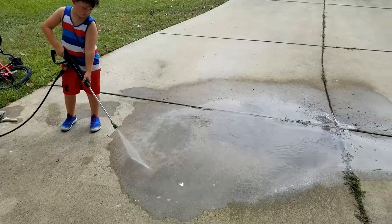We're out for the obligatory test drive after getting everything put back together. I got the front differential filled up with new gear oil — that Valvoline full synthetic 75W-90. So far after a few miles I don't hear any clings, bangs, pops, anything like that — so far all is good. I had my son pressure wash that old oil spot area in the driveway. I just wanted to get that area cleaned up, have a clean slate, so to speak, just so I can check tomorrow morning if this thing is still leaking, which hopefully it's not. I feel good about that seal install, but only time will tell.